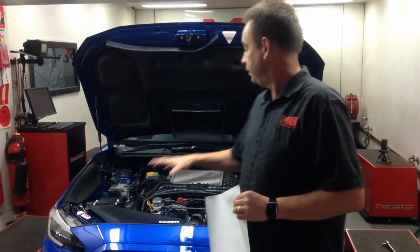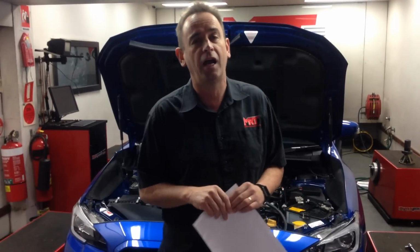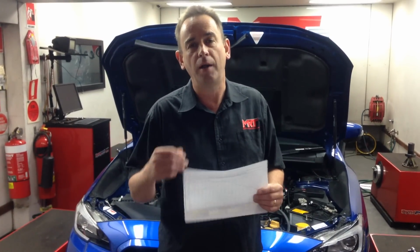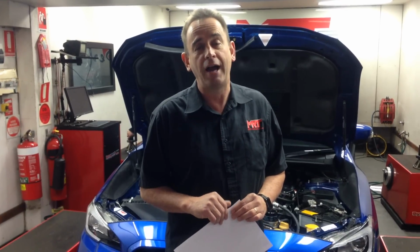Now, one of the things that's also in the overall package of the engine bay with the tune is that these particular cars, when they have a cold start, have a really funny echo in the air intake system as part of the cold start program. And part of the tune that we've developed in combination with the exhaust system is designed to keep echoing type noise down to a minimum when the car starts in the morning when it's cold. So if you're living in an area where you might have neighbours who may be a little bit sensitive to excessive noise, or you just don't want that horrible noise when you jump in the car yourself in the morning because it can be quite annoying, this exhaust system combined with this tune is designed to keep the noise down. And believe it or not, with enough R&D, you can test and change the cold start parameters in the factory ECU tuning as part of the tune package to reduce that type of droning noise. And that's one of the things we're very proud of that we can elaborate on as part of the upgrade.